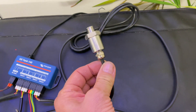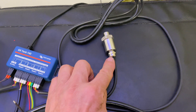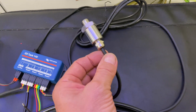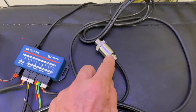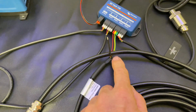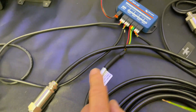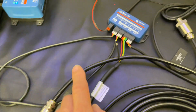This one here is a more compact version — the differential pressure sensor is in the back of the gland here. If you drive through a water crossing and park in the middle of it, this will destroy this unit because water will come in through the back. Whereas this one here won't be destroyed because the differential pressure reference is up through the tube. Both use a MEMS chip that's bonded in — all digital.